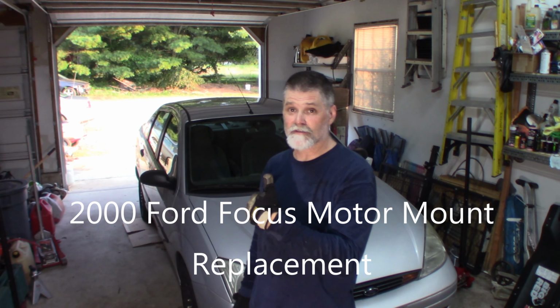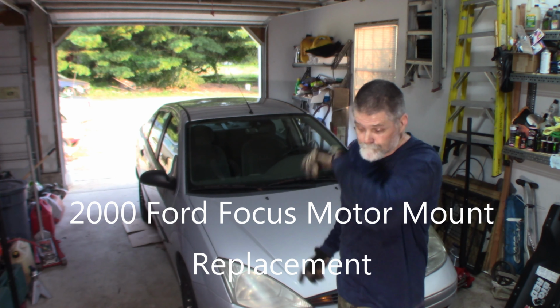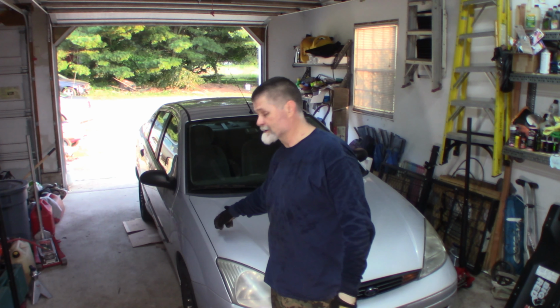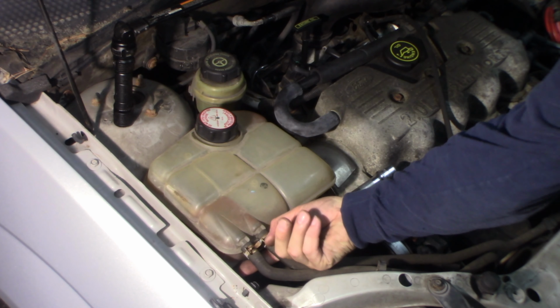Well, we're back to the 2000 Ford Focus. I've replaced the rear torque strut underneath on the firewall. Transmission mount, still have the vibration. Now we're going to replace the main motor mount to the passenger side at the top and see if that fixes the problem. So there's one bolt right here that holds this overflow reservoir in for the coolant, 10 millimeter